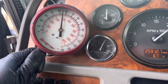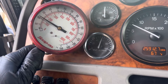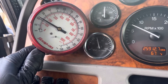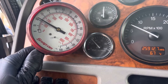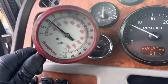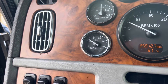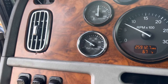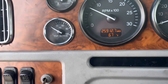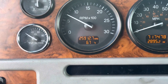I don't see anything wrong with this at this point. The customer just had the oil and filter changed, the oil level is good, and this truck has been sitting. Maybe there's some issue with the oil pressure gauge itself in the dash on the Peterbilt side. But checking it with the manual gauge — that's the important piece here — we've got good oil pressure all the way around. We're going to turn him loose and have him watch it really closely. Thank you for watching.